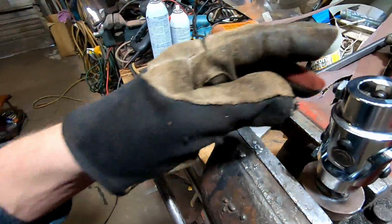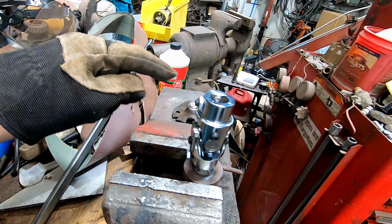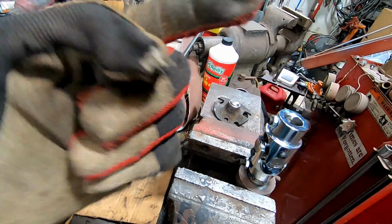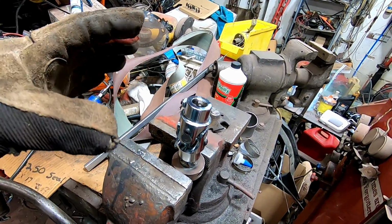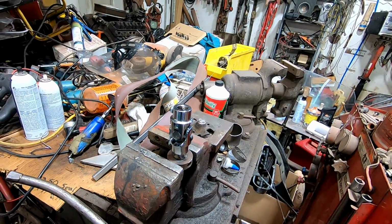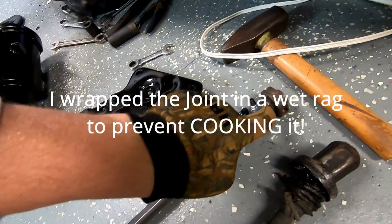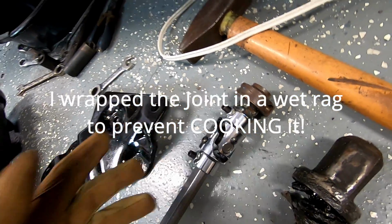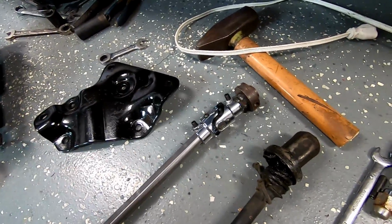I'll get it turned sideways and do it, but after that point, I gotta call time out because I can't weld this end back on our shaft end because one, I don't know the length, and two, I need to clock the steering wheel correctly inside the truck, or it'll have a crooked wheel the rest of its life. So I cut off a piece of the D shaft, slid in, made myself a little bit of spacer there, welded 3 different ways. Went ahead and tightened up my set screws and all that. I didn't have to have those.